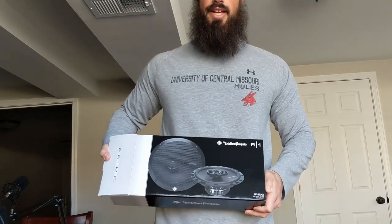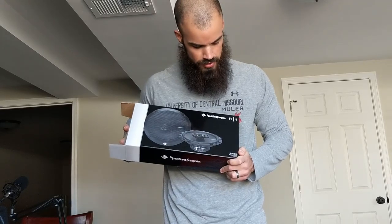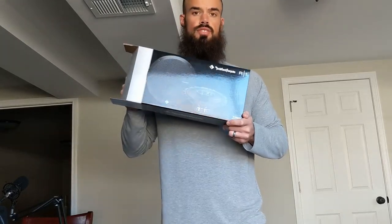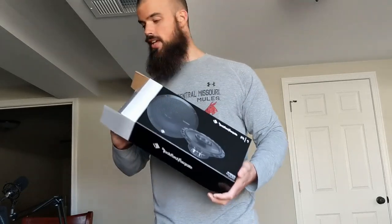my wife, who works really, really hard and is this awesome chick that's way too good for me but she doesn't realize it, is going to be getting a system in her car. She has a 2014 Chevy Captiva, which is basically a baby Equinox. So we're going to be taking four of these Rockford Fosgate R165X3s and putting them in the doors — a simple factory door speaker replacement powered by the stock head unit. Rockford Fosgate.